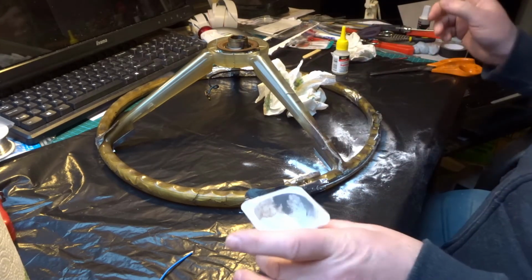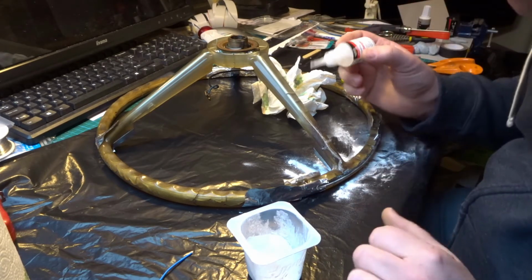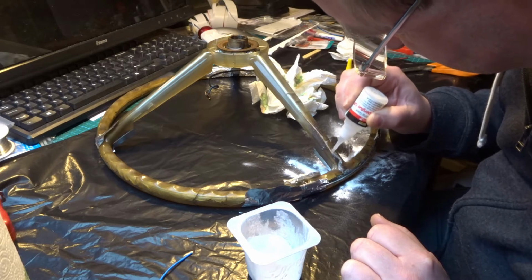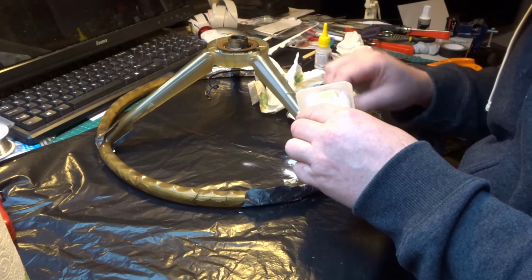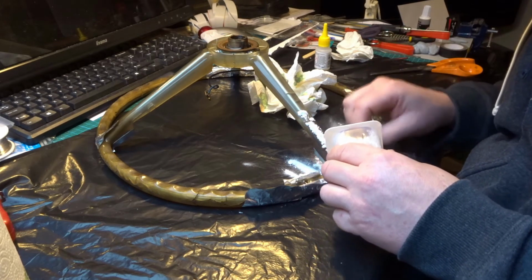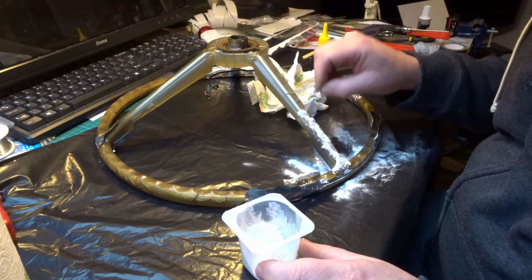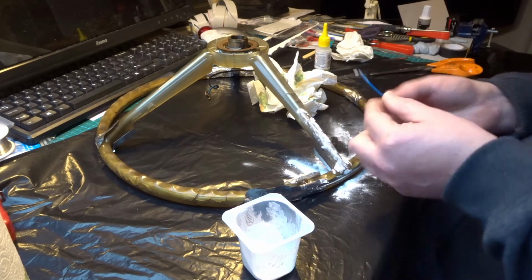Right, see how that's formed a kind of solid gunk in the crack. It's still a bit recessed, so I'll just try and build another layer up. I don't know what it's like. It sets like concrete. So I started off carefully trying to get it into the crack, but this way seems better. You just sort of massage it in, and you waste some. So that will now react again. As it sets immediately, and then flick it off.